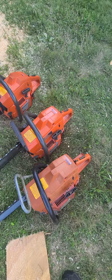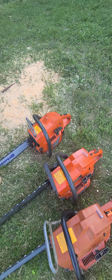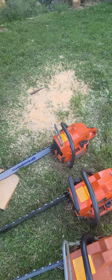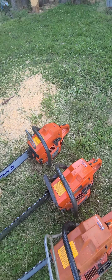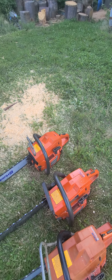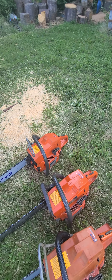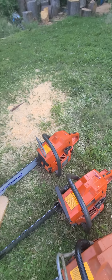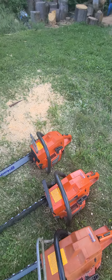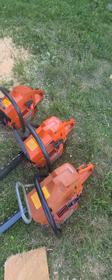I'll show you how it performs against each other. I also have a modded 61 over there in the corner — interesting saw about that. A guy came in, kind of burned me on Craigslist. Told me the saw was good, but the saw was fried. Anyway, totally went through that one, put a 266 top end on there, ported it, and the saw runs sweet now. There's a video about that.